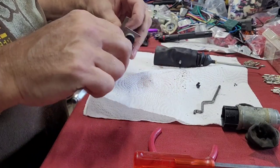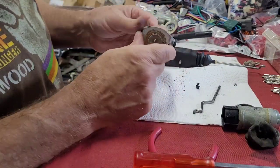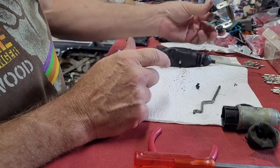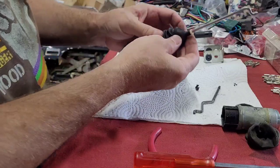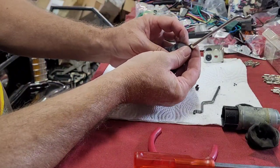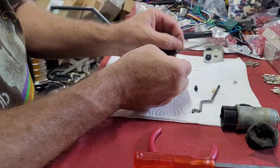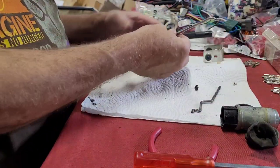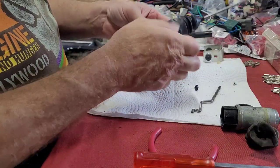Okay, so the metal bracket that's threaded for the Phillips screw in the back of the door has the bushings in it that we're going to need. Now this Bronco one, some of them have wire ties. This one has like another little C-clip on it that we're just going to pop off. And we're going to pull the rubber up off of it.